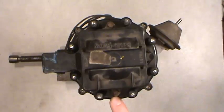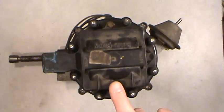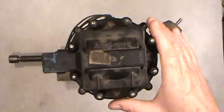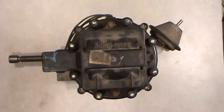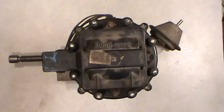This covers up until the point where they started adding computer controls and then moved on to fuel injection, more or less getting rid of the distributor. This particular HEI distributor is out of a 1979 Chevy van — it had heavy-duty emissions, meaning a lot less pollution control stuff on it, so it's fairly basic. It's purely mechanical with some electronics in it as well.